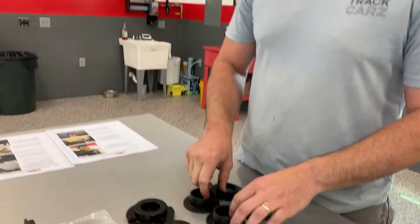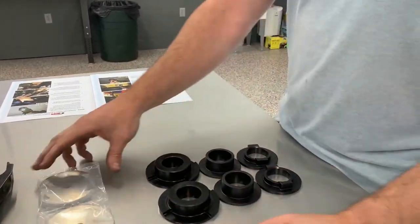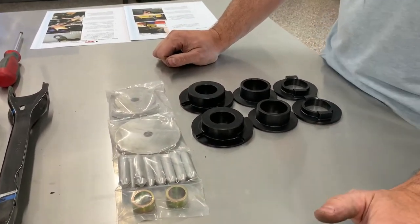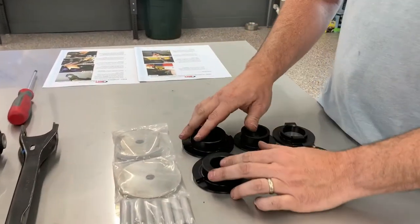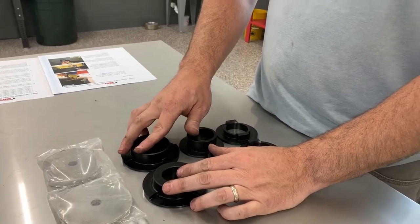In my last video, we talked a little bit about the rear suspension, the control arms. In this video, I'm going to go over how I'm installing what's called the BMR lockout kit. What this lockout kit does is essentially takes all the play out of the rear cradle, the rear subframe bushings, and makes the rear end more rigid. BMR touts better handling, more predictable handling, improved launches if you're drag racing, just better overall performance.